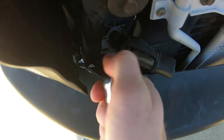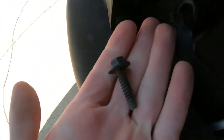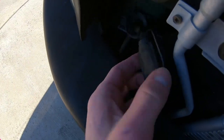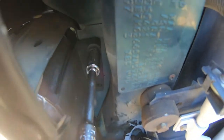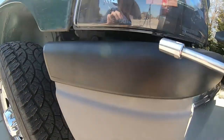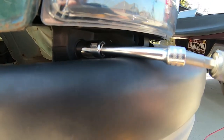Just start working it loose. It's a bit tight of a reach down in here from the top - just let it drop out the bottom and catch it on the floor. You've got to be careful if you've got a block heater; this right here will tear up your hand pretty good. The other fasteners are pretty self-explanatory. This one here is a little tough to get to, but if you're careful you can get on it - you might just have to bend your plastic bumper trim down a hair.